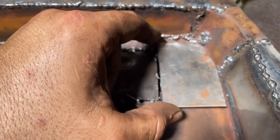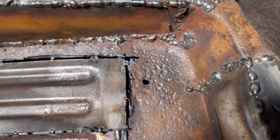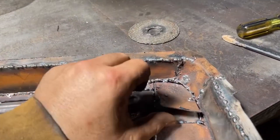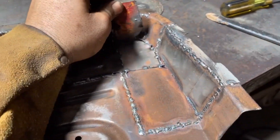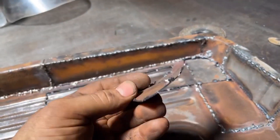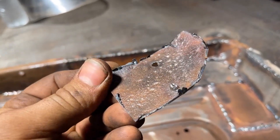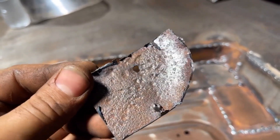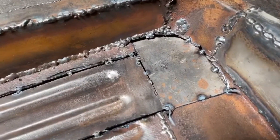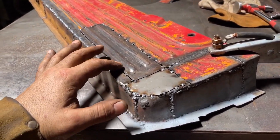Took a second to round over that edge — going to be replacing a lot of bad, tired metal in there. That's basically tacked in. Here's our bad metal, held on by a single weld now. So we're removing this — this is just future-proofing. I probably could have left this in and it could have been good for, who knows, 10 years, but eventually that stuff's going to rot through. Better to have this. So with the fun fitting and tacking done, I can go ahead and completely weld these up.